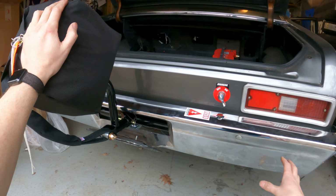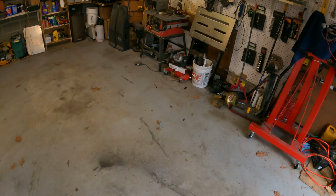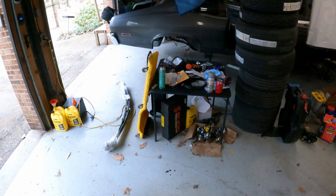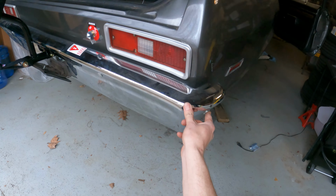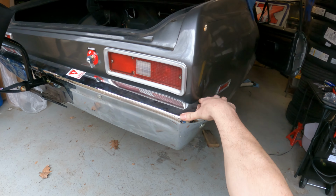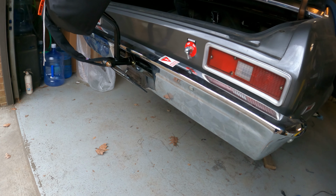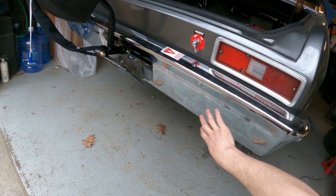Go ahead and pull the entire bumper off. It replaces the factory bumper brackets, which I've got over here in the scrap bin. Replaces those, and then the bumper mounts up to the same location. The only location that doesn't mount up is this one. Ooh, I must have gotten into the paint. Thank goodness the paint's ugly on this. I did drop the bumper once. But it mounts up here, then the two underneath, and then all the factory chassis locations, which I don't know if you're really going to be able to see too well, are underneath there.